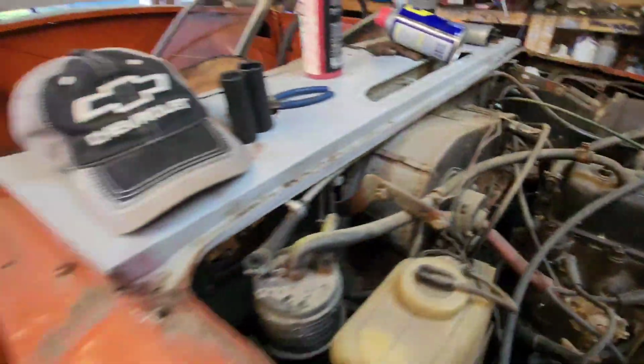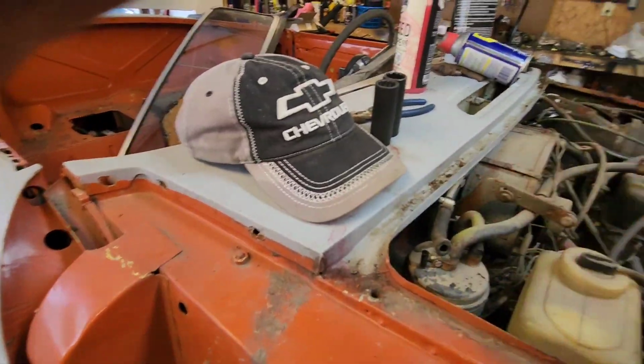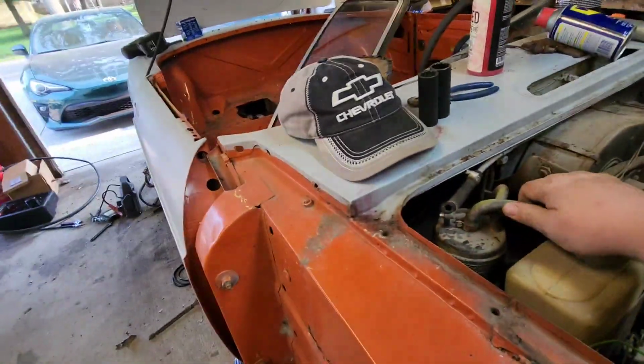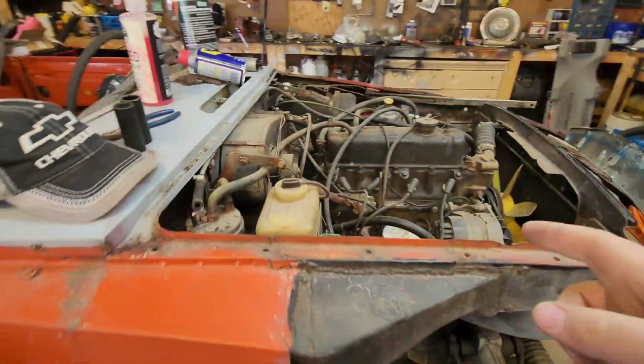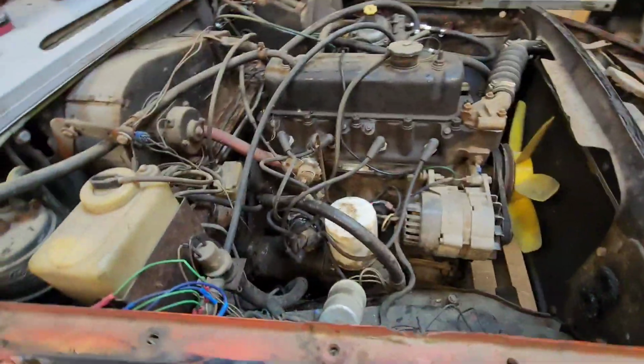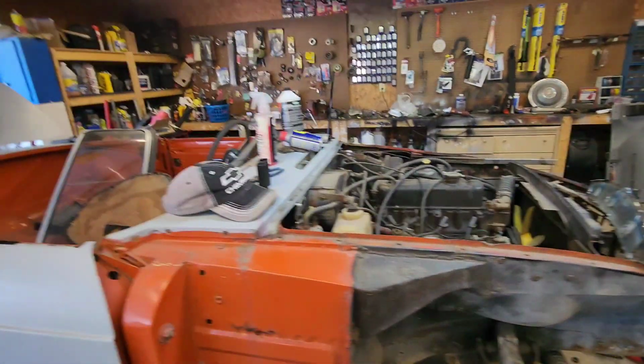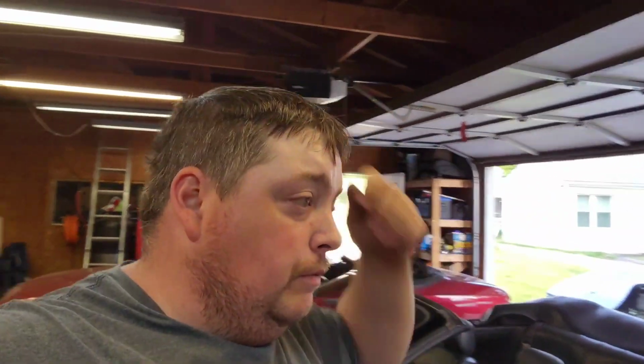The float did stick the other day, so I think we're going to run this line just straight down to the ground for the moment instead of hooking it back into here, just because I don't trust the whole idea of that being back in the system. We will probably go to O'Reilly's, get an oil filter and some oil, and do an oil change on it. Give it some fresh 20W50 to chew on, and start getting brakes on it in the next video, because that's the next big thing that it needs.